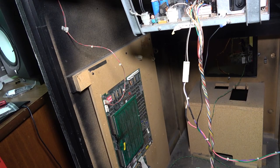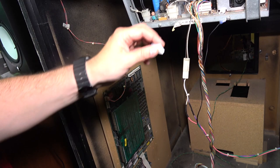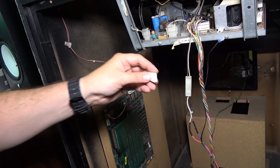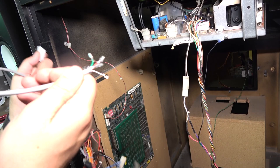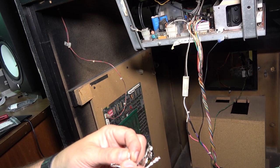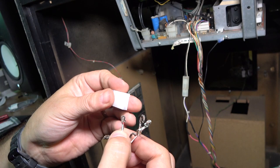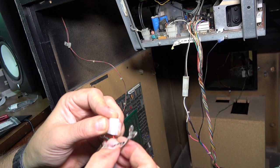I dropped it. It can't go on with the ledge facing backwards. See, it hits that thing, right? So we know that red is going to be on the far right here. So let's take our wires and go ahead and put red in first. And you could tell which way it goes in because there's like a little slot back here. And this flat side, not the grabber side, goes in the slot side, like so. And you just kind of push this in there till it clicks.